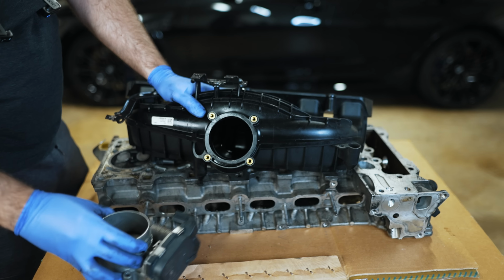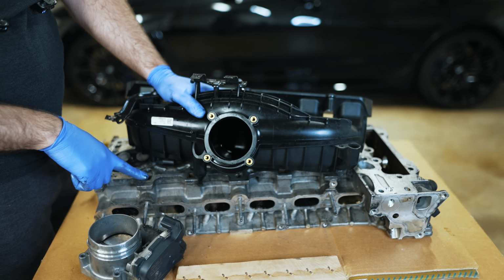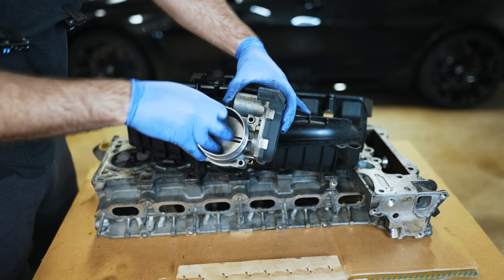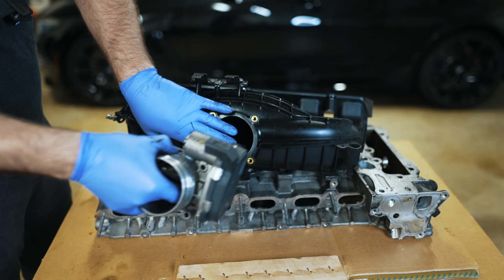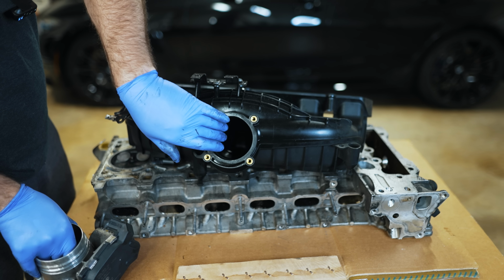Now, if you had to ask me, why didn't the N54 come with Valvetronic? Because the N52 was out at the same time. It's because they didn't have the technology in terms of boost control, not quite figured out yet. So on an N55, for instance, or B58, if the throttle is always open and you let off the gas, is there really a whole bunch of excess pressure that has to be dealt with? Yes and no, but not as severely.